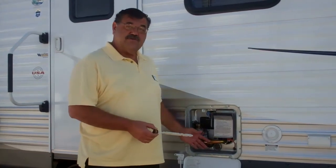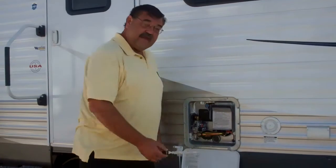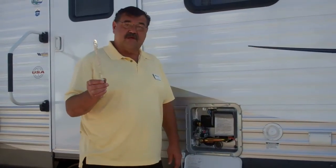So again, make sure you always drain your water heater when you're not using the camper. Refill it when you go back out again. Make sure to put your anode rod in. And again, that's our RV Tip of the Week. Ellen Buettner, MidState Campers, 605-431-3245 or 605-787-7453.